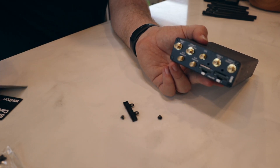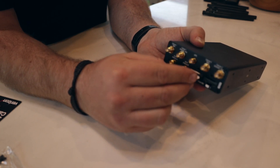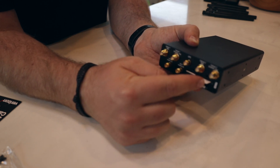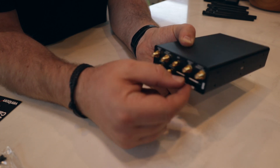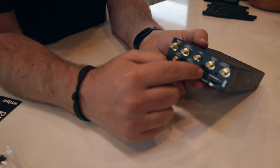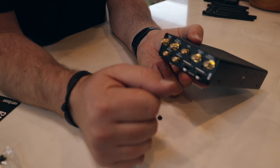If I wanted to put in a second SIM, I could do it in two different places — I could put a backup SIM onto the same modem as a failover, or I could put it on a whole second modem so it could always be running. Sometimes when putting the SIM card in, it's already compressed — so don't over push it. Just with one finger you can push it and get it seated. That's a very important step.